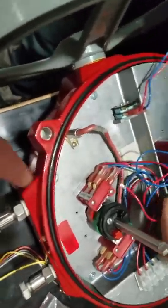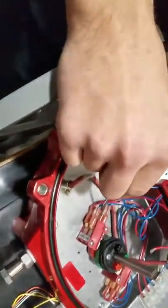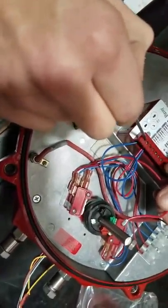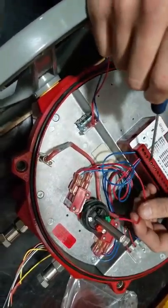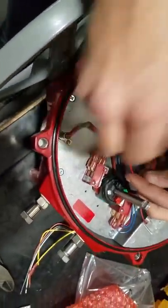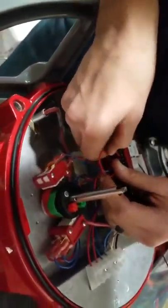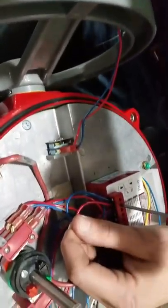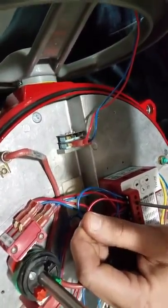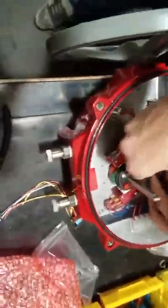And those are coming from the inside here, right? Mm-hmm. If you're standing at it in my position, the top side goes to the bottom two holes, and the bottom side goes together in the top hole. You got it. Bottom three for this specific arrangement. And what was the blue and the red again? Blue is always open and red is always closed. Cool. We're going to try to make this as neat as possible when we go through the zip ties. Yeah, looks good.